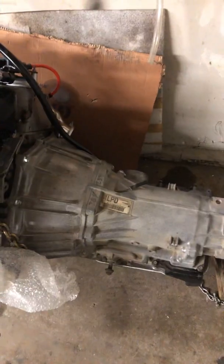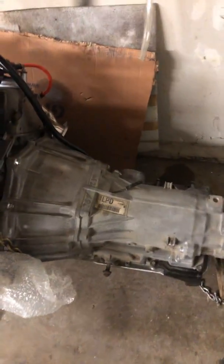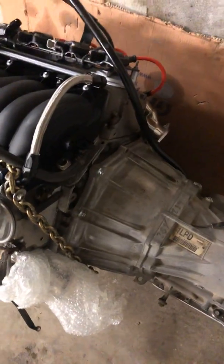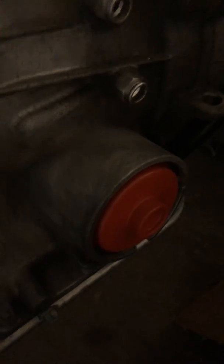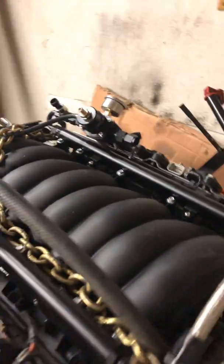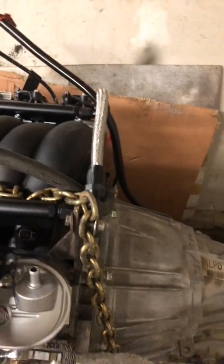The 4L70 — they're very hard to tell apart with the three-piece casing. I got a 2400 RPM stall converter in it. I also got a Corvette servo — it's painted red, I think they're remanufactured with all new seals. It's going to shift a lot harder.